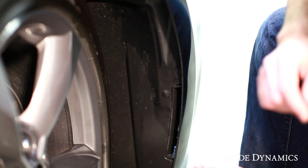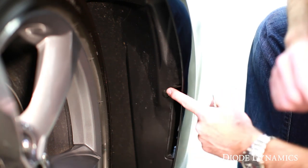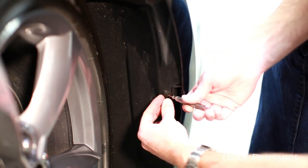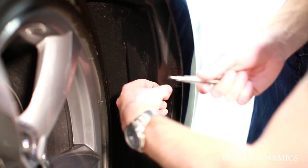Let's go ahead and get the HP24 installed — it'll only take about two or three minutes because we don't even need resistors. All we have to do is access through the wheel well, which is really pretty simple. There are just three locking screws to remove. Just get your flathead — there's a nice slot to push it back and then you can pull the entire screw straight out. Do that for the other two as well.